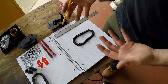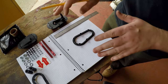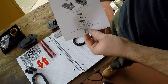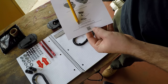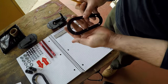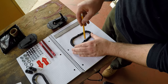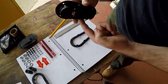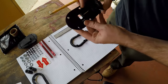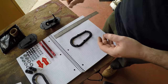You've got to make a template for it. Now some of the AeroCatches that you'll buy will actually come with a template on the box itself. The kit that I have does not. If you look on the instruction manual it tells you right there: mark around the inside of the fixing plate. This is the fixing plate. This is going to give you an outline of what the inner part of this needs to mount inside your hood. So I'm going to go ahead and start tracing this out and figure out exactly where that point is where the hood pin comes through.